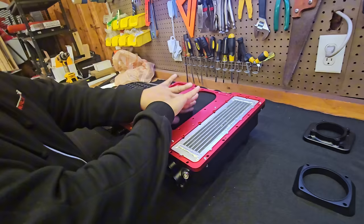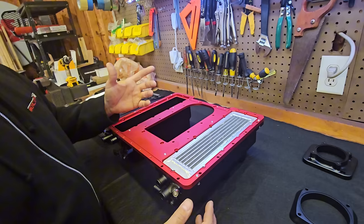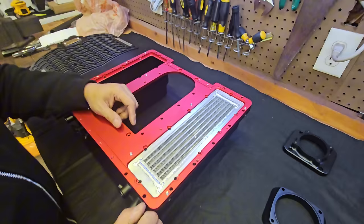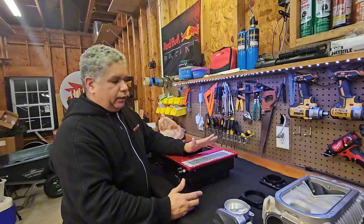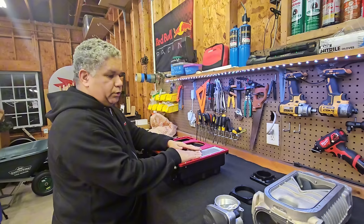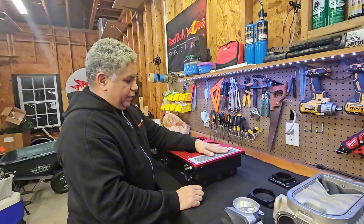The cover goes on top and air flows right into the cores — they are 3 inches deep and do a good job. Right now they're being track-tested by 034. Due to the efficiency of the blower, we're finding the cores are more than sufficient for the 3-inch setup — we're not maxing out the blower so we're not getting crazy high IATs. It's an overall way more efficient system. We're limited by the available space no matter what, but we're working on a possible version two of the cores — not anytime soon, but it takes a few months to go through that process.